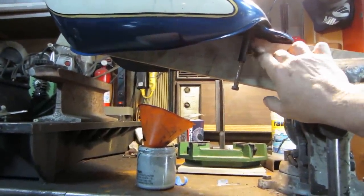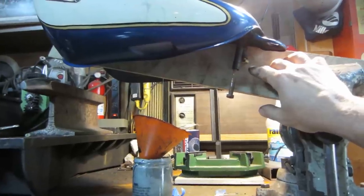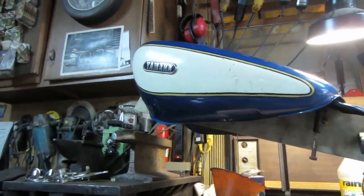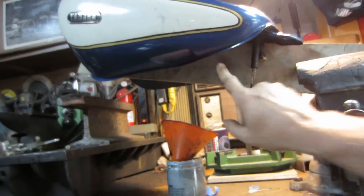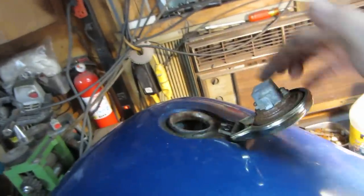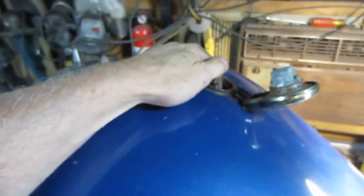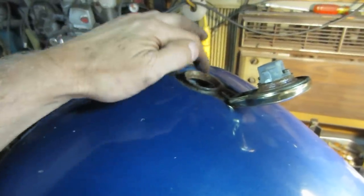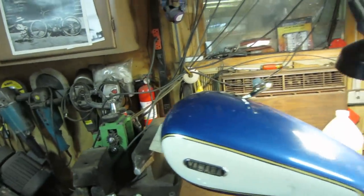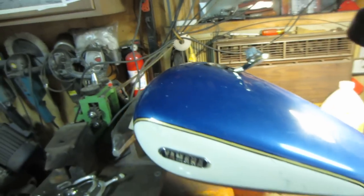Once in a while I've got to come back after I pull these and blow them with air to make sure these two passages stay clear on the inside. Sometimes you could jam something up inside them when it's still curing — like a coat hanger or a drill bit depending on whether it's a straight shot. You've got to make sure you've got that passage open because on this one they kind of go up in the tank and bend down somewhere. This tank also has a lip about that deep in the top — that's why I couldn't pour it back out from the cap. That lip is meant to maintain a vapor space.